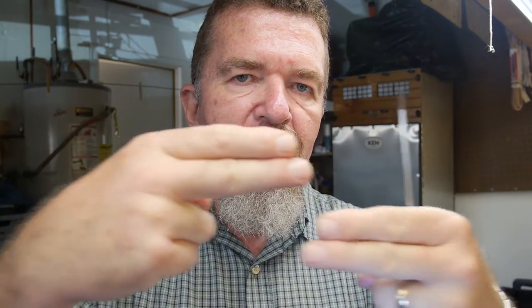Before you go into the machine and just start adjusting things, you have to do a test on your machine to see more precisely what the problem is. There's a certain order that you want to do this adjustment in. I always recommend that the first thing you want to do is adjust the lower case position. It might surprise you to learn that there are hard stop adjustments not only for the upper case shifted position, but also for the lower case, to make sure that the letters are all printed evenly so the tops and bottoms are all nice and dark.